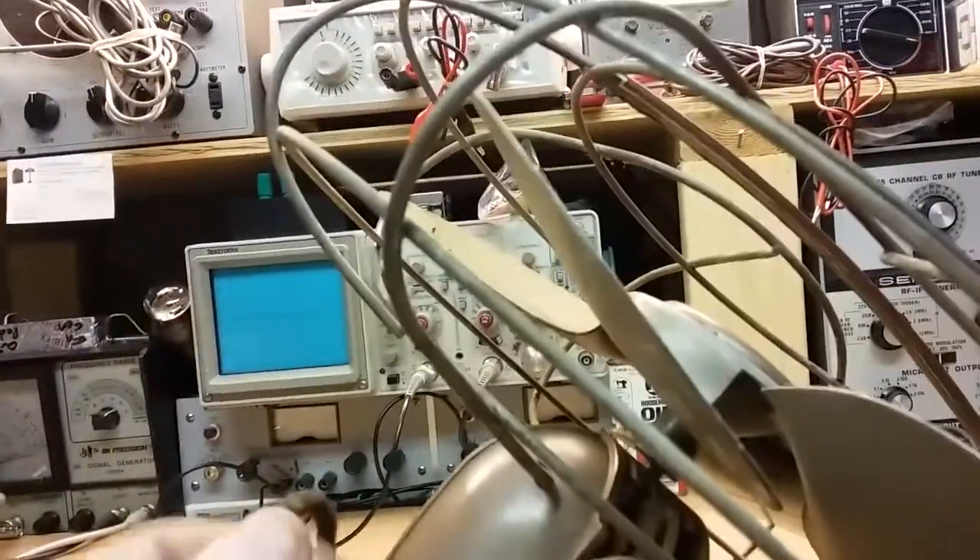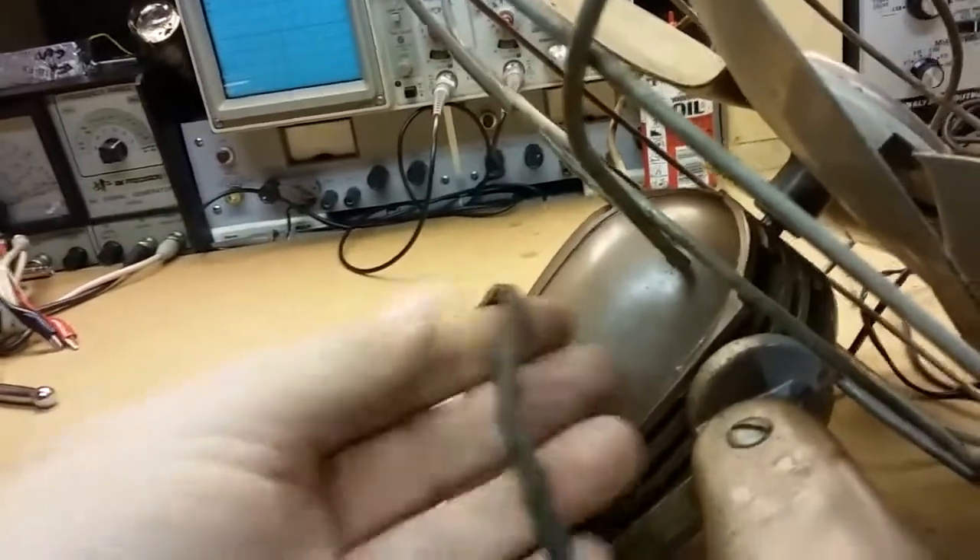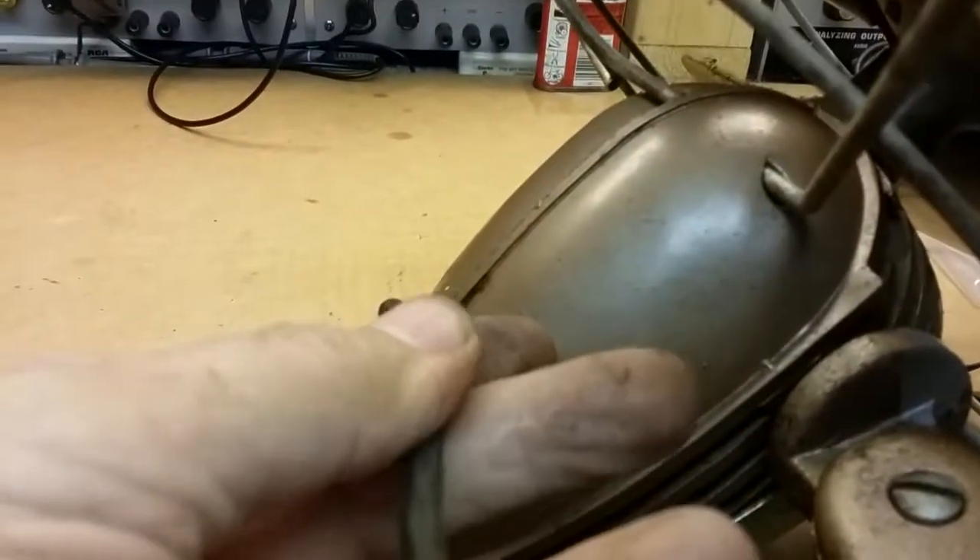The bottom's clean and everything's clean. I would definitely suggest replacing the head wires — that's a little crispy. I'll look at the motor when I take it apart. If I could replace these grommets, they're in bad shape and should be replaced. I can always take the wire off and slide new grommets over it, and I can clean this wire up. Or we could put a new cloth wire — it's sort of the same kind of cloth-covered cotton wire I install on these. This one is brittle, which means it's old. As I'm moving it, listen — hear that crackling? It needs to be replaced. We need a new head wire.